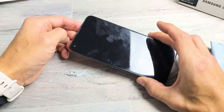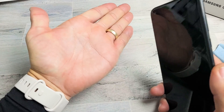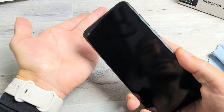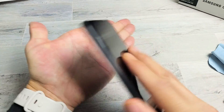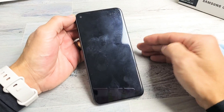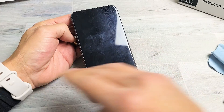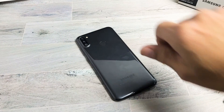If you're still down, the next thing is what I call the smack method — because you're going to smack the phone. Put your palm out like this and smack the screen, looking at it each time you do it. You might see something flashing or the screen might turn on. Also do the bottom, then turn it over and do the top back and the bottom back — all over. If your screen is still black, do the same thing: force restart it, press and hold both buttons, do not let go until you see the Samsung logo appear. Most of you guys are up and running now. However, if you're still down, start at the beginning of the video and do every single step — try every step multiple times. Thumbs up if it worked for you, thumbs down if it didn't. Good luck.